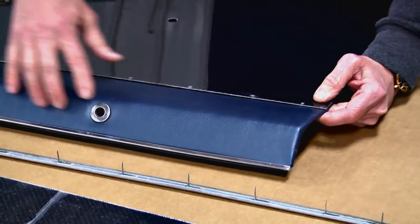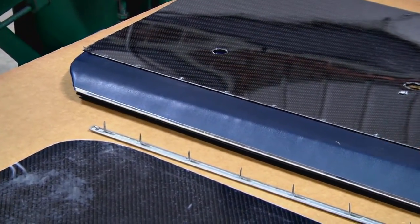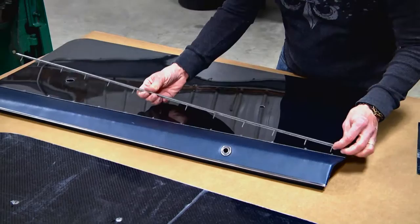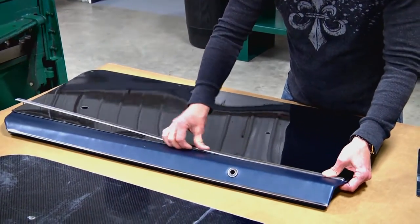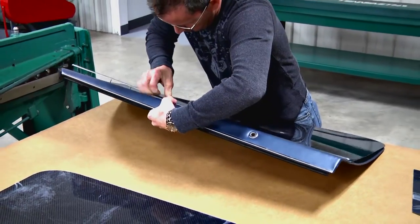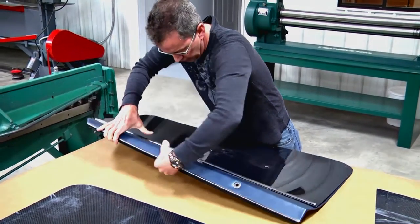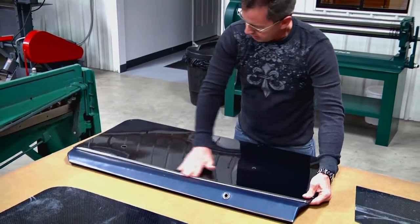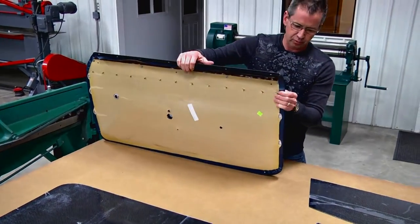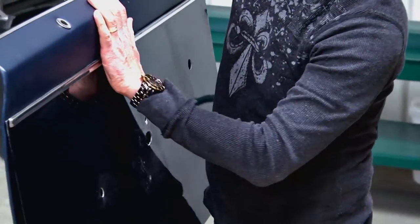We want to retain the stock felt and the door lock closure at the top of the door because it's molded over, so this flat panel will look really nice with this still on there. Once these holes are located, you can use the door panel to mark them. Then you're going to take this and put this stainless piece back on, push it through, and make sure it all lines up with the little holes. Once that's all in there, hold it tight with your hand, take the tang and push it over and flatten it out. Now the top part of the door will be attached to this carbon panel, and it will clip back on to the door.